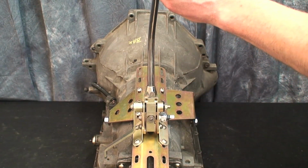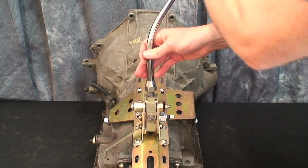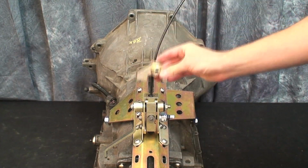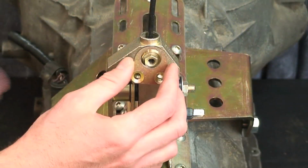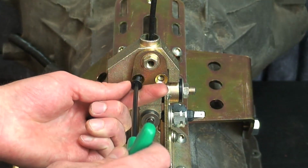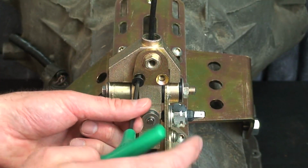Remove the shifter arm to expose the shifter cable, and slide the side shifting adapter onto the lower shifter body. Install the bushing supports to both sides of the shifting adapter and secure to the shifter body with 2 Allen screws.